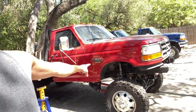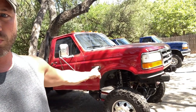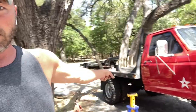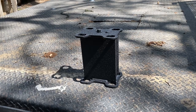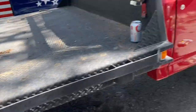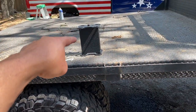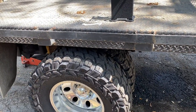We're back under its own power — now time to get started on the back. Today we're putting on the eight-inch block from PMF. We already did the front suspension from MDK — the coil conversion from leaf spring to coil with a four-link, Fox shocks, and Icon springs. Now we're doing the PMF rear block, taking out the stock four-inch block from the cab-chassis and putting in this eight-inch block. Hopefully that gets it close to level; if not, we'll add a couple inches of lift springs in the rear.